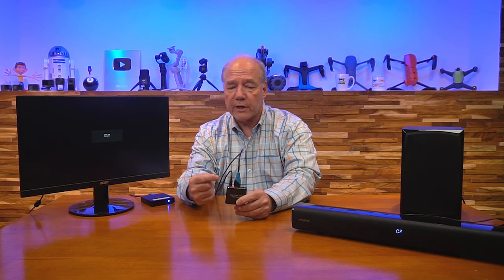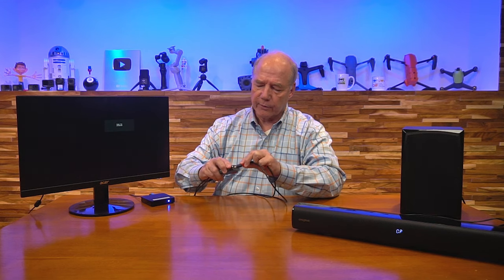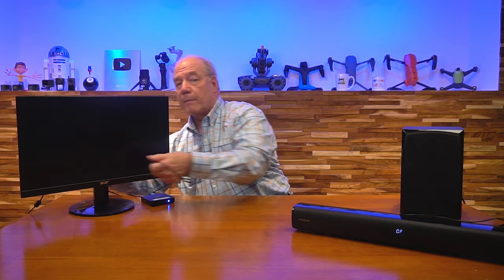Now I'll add power — I've already plugged the power supply into a USB charger, and I'll connect the micro USB into the back of the unit. Once power is added, you'll see the red LED come on as it goes through a power-on self-test, analyzing the HDMI media stream and starting to extract the audio. Now I can connect the extractor back to the monitor using the second included HDMI cable. The video comes back on the monitor, but I still need to connect the audio outputs.